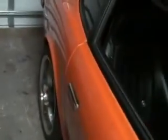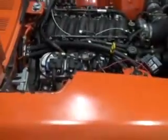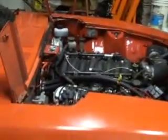Right now, since it's a 280Z, I'm running the stock R200, so the differential is fine. You don't really have to do anything to it. I do need an LSD though. I don't know if you can see my tread. You've got the tread on that tire, then you've got no tread on that tire. So yeah, I want to run the 300ZX diff swap, whatever you want to call that. I still have to do more research. Yeah. What else?